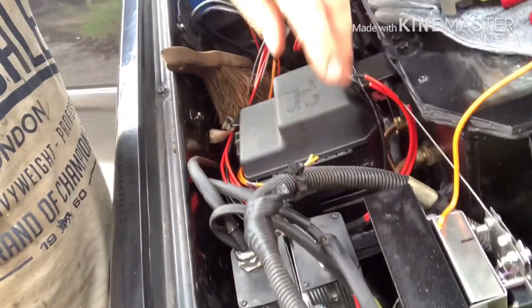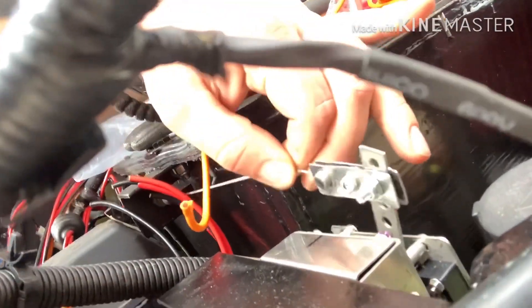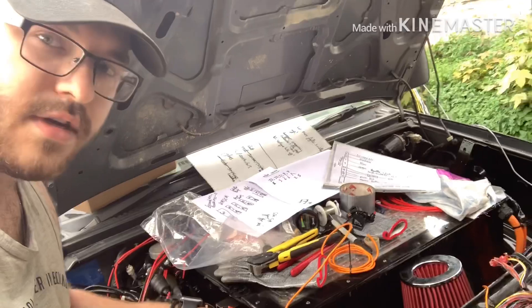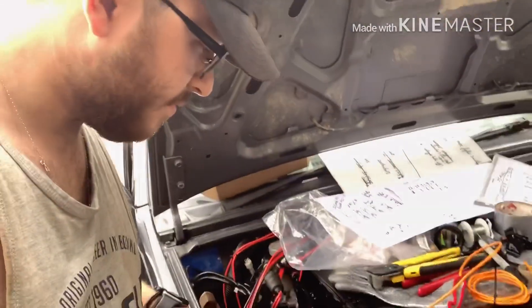We have here our two DC-DC converters. We've got a throttle with a bit of a jerry-rig throttle assembly. Made it out of some really thin steel so the idea is that that's the weak link, so if anything was to go wrong I won't damage the pot box that goes into the Curtis controller and it won't damage the standard throttle — that's basically why I've done that.